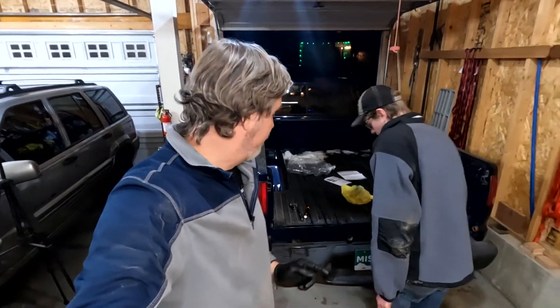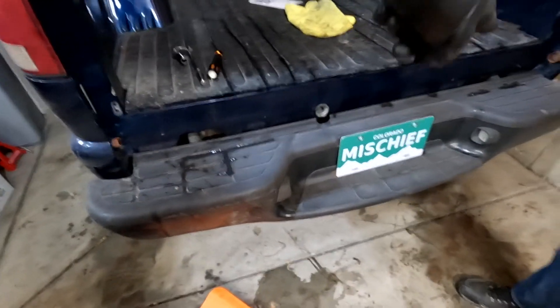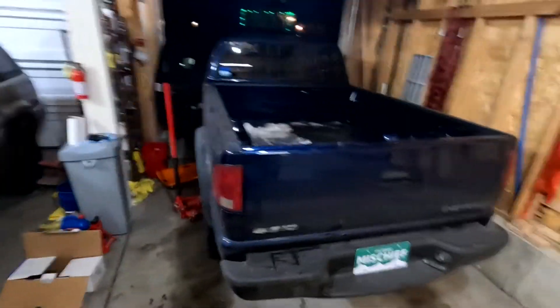That's what it was. If you guys are doing yours — it won't work with the electrical disconnected on the bed, so you've got to have the bed hooked back up or run a jumper wire for the ground. The ground is right there on the frame, and it grounds the fuel pump through there. Now all we've got to do is bolt the bed back down, hook the gas tank fill neck back on, and she's all done. It's all back together, looking real good, runs great, nice new fuel pump. Hope you enjoyed that and hope it was helpful. If you did, like and subscribe, and check out our webpage for the merchandise — some pretty cool t-shirts.